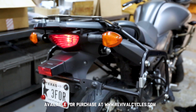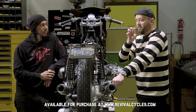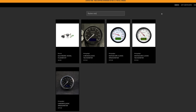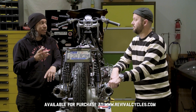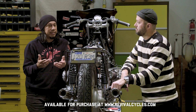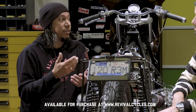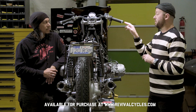You want LED turn signals, and you put them in and turn them on and they flash really fast. With a filament and a factory flasher it blinks at a normal rate, but put an LED bulb in the exact same fixture with the same flasher and it goes really fast. There are ways to fix that. On an older style bike you can change out the flasher relay — there are different kinds, some the same size as a normal relay, some a lot smaller like the ones we sell. It's solid state, so there's no physical switching, and that'll slow it down and make it nice. If you have a newer bike with a CAN bus system that doesn't have flasher relays, you can put a resistor inline for the turn signals. That inline resistor creates the resistance the factory flasher requires so the flash interval of your turn signal is more consistent and regular.